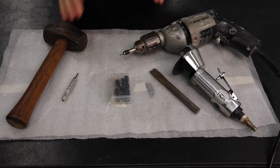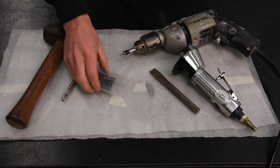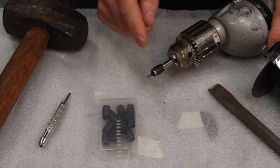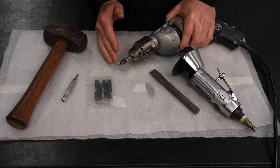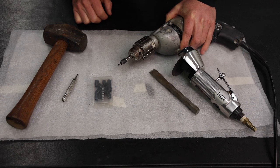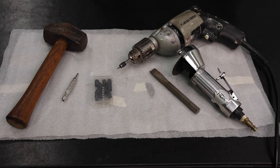Now this is what you definitely want to get — I'm not sponsored by this company, I just love this tool and it's really a game changer. It's a spot weld remover drill bit. As you can see, it has the center point and then the drill bit itself. This will get the spot welds out way more precisely, and there's less of a chance of going right through. If you use just a regular drill bit, there's a greater chance you go straight through the spot weld and then you have a hole in your frame — and we'd rather not have a hole if we can help it.